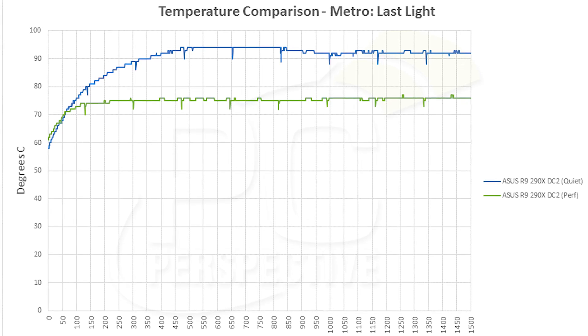In performance mode — the default setting used for most of our benchmarking — the cooler was able to keep the GPU at around 77°C and maintain 1050 MHz clock speeds throughout an entire 25-minute run of Metro Last Light, while being 6 dBA quieter than the reference cooler. So it was quieter, cooler, and had better performance. Comparing it to the Sapphire reference cooler R9 290X we purchased, even though there should only be a 50 MHz difference, the average clock speed delta between the two cards was actually 178 MHz — largely due to the clock variance issues on the reference design.